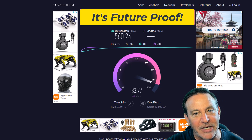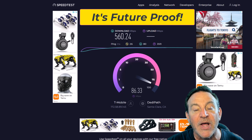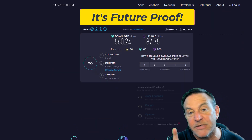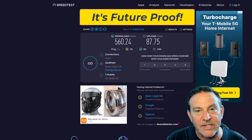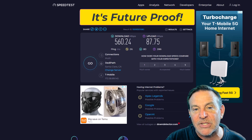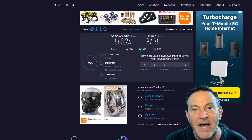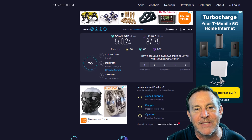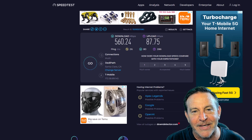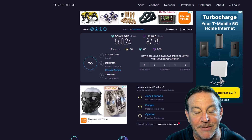N77 is going to be amazing as soon as that one's available. This antenna will cover 600 megahertz — that's N71, a very important one, our extended range band for T-Mobile — all the way up to 6,000 megahertz or 6 gigahertz. That is the sweet spot for home networking. Anything above 6 GHz is not worth chasing because you'd have to be within a couple of blocks.